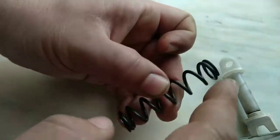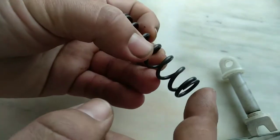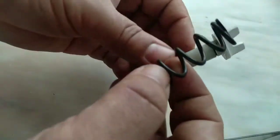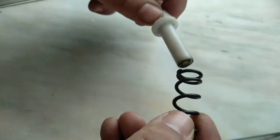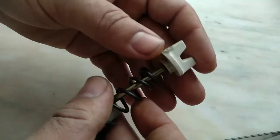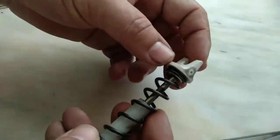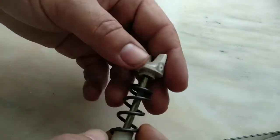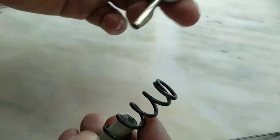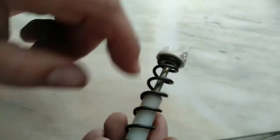As you can see, on both sides the spring is cut very well. It is finished on this coil here and on the other end too, and that is important for the spring to sit on these two parts very well. You can buy a longer spring and cut and heat it, but if you don't have a perfectly seated spring you will damage these two plastic parts.